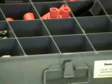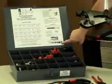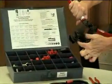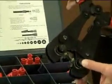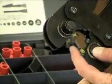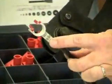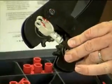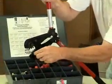Now as I demonstrate this hex crimp tool, it enables you to crimp from 6-gauge all the way up to 6-aught-gauge in cable ends. With the color-coded die settings in here, these crimp dies, you can basically push down on this spring-loaded lever and spin around these hex dies to the position that you would need in order to crimp the color-coded terminal. In this case, this is a gray number 4 25 hex crimp, which is also listed here. It says 4-gauge 25. I know you can't see that from here, but that will give you an idea of how to crimp the connector into the crimp tool.